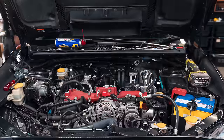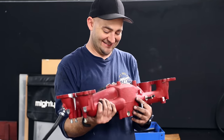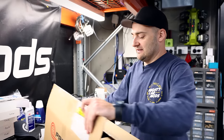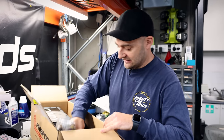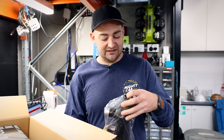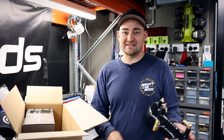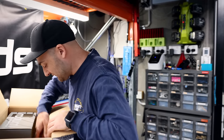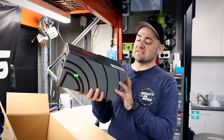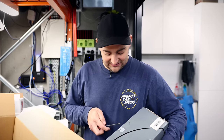It turns out the kit I've got replaces the entire fuel system inside the engine bay - it requires the intake manifold to be completely removed and lifted up out of the way, which is a pretty big job. But this makes room for some clever upgrades and helps tidy up the engine bay. The intake manifold is now off, and I have a box of goodies from Pro Speed Racing, who are an Australian distributor doing lots of mad Subaru stuff. We have an under-intake manifold intake pipe - the factory ones can split under big power and heat, so this is a mad upgrade. While I'm in there, I'm going to simplify a bunch of stuff and delete the TGVs and other things that get in the way.